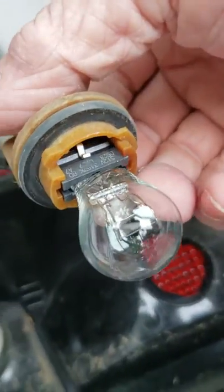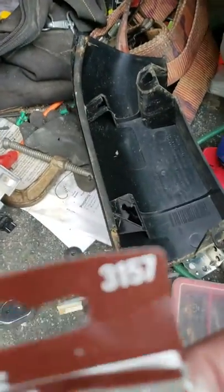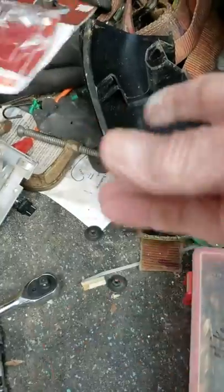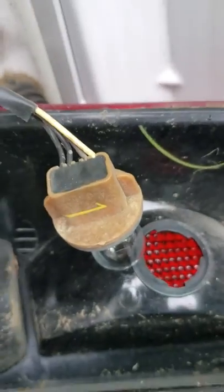That's all you have to do. Then take it and twist your bulb to the left — right there it is. Just pull this out with your hand, push your new one in there. The bulbs are 3157 — make sure you got those. I would replace both of them since you've got it off, because it comes in a two-pack anyway.